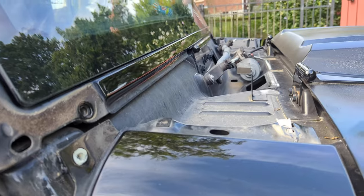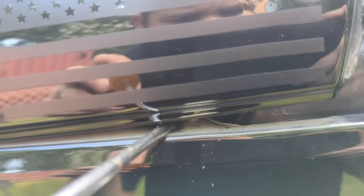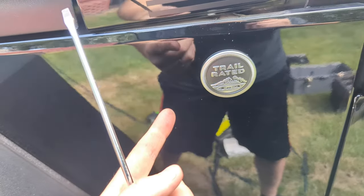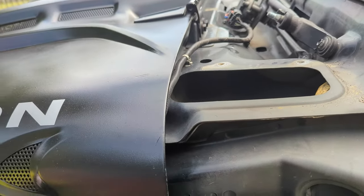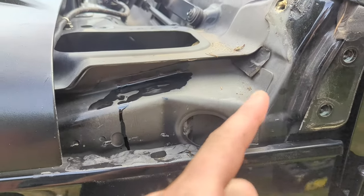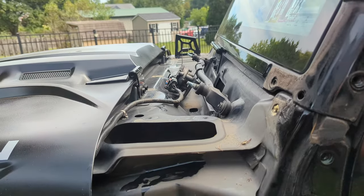So far not too bad if you've got the right tools. You're gonna have these little rivets inside here — you just work yourself around it and keep pulling until it eventually breaks. Keep twisting the metal, you can bend it a little bit back and forth, wiggle it a little bit — not enough to flex the piece too much. Having a tool with a metal blade is going to be very crucial, because if you're just working it by hand it's going to take you probably hours. I tried it by hand on this side and it took forever. Just get a cutting tool — you're going to want to cut that out. Then we're just installing the brackets.